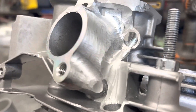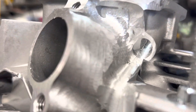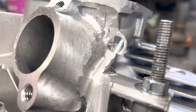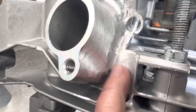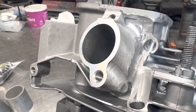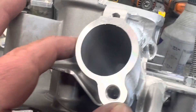This is what we ended up with. We've taken and just come over this with the burr — we still haven't gone over it with a sand roll, but this is just the first step. This is the oil passage that would have normally been here, coming out here and going up here. We're going to fill all of this in and build it up with weld, fill this all in and fill over here with weld.